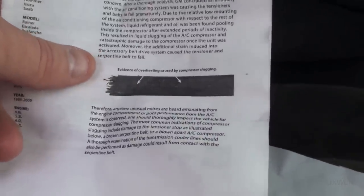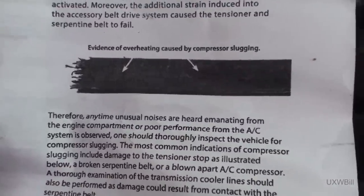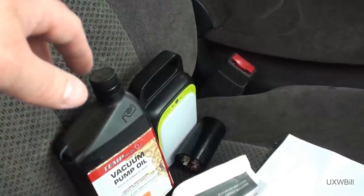You can very clearly see where that tensioner pulley got into the surrounding metal as it started to run more and more erratically over time. There's a yellow service bulletin sticker on the box — it talks about failures of this pulley having been observed as a result of liquid slugging in the AC compressor, and it actually mentions the compressor potentially being blown apart in addition to damage to the tensioner. The good news is our tensioner does not appear broken and our compressor is not blown in two. I don't think that was the mechanism of failure here — I think the thing just mechanically wore out.